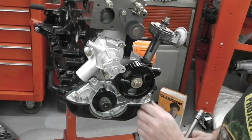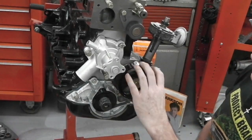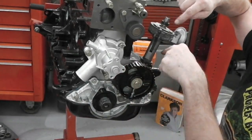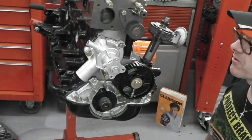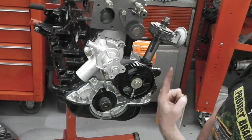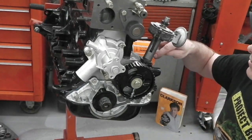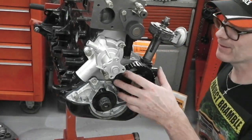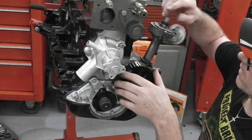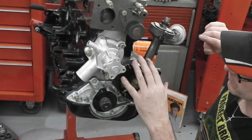Okay, here we go. We've got a sprocket on now. Auxiliary drive sprocket. And that's turning the distributor there because it's all linked together. The hex bar, I mentioned earlier on about the hex bar, it's already on the pump, sticking up inside it. I thought you dropped it in, you don't, it's already on the pump. That drives the distributor, also drives the pump. It's driven by the cam belt itself.